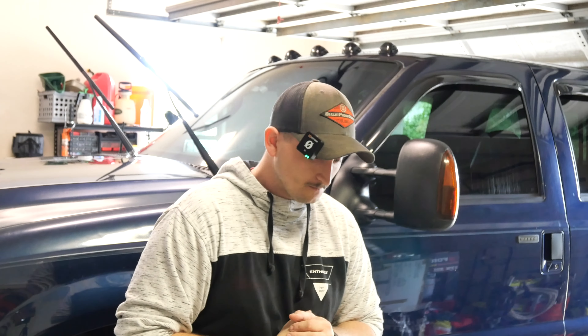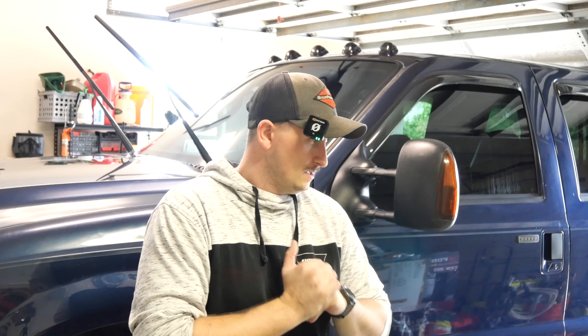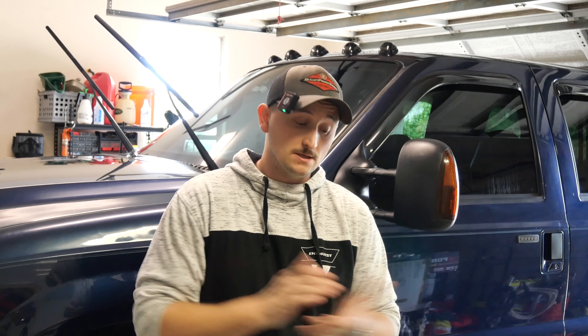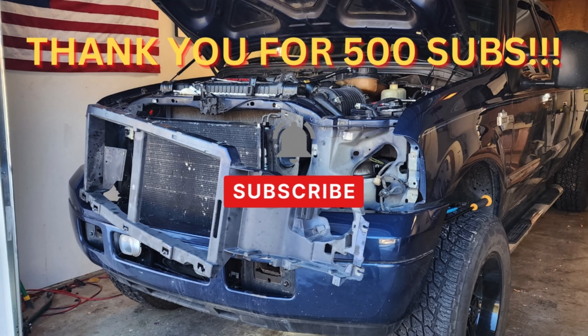This is applicable in under 15 minutes — it goes really quick and really easy. Step one is going to be clean your windshield, scrub it up, make it really nice. Make sure you wear gloves — this stuff is nasty. Once your glass is clean, then you spray this on there, let it sit for about two minutes, and then you buff it off. It's super simple. And if you have any questions about how to do it, it gives you step-by-step instructions.